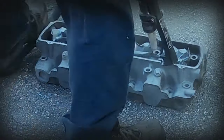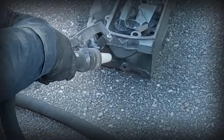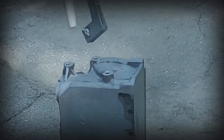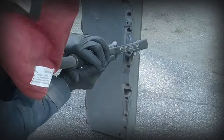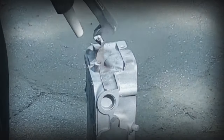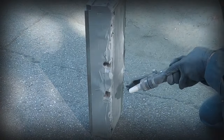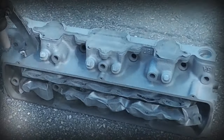First off, the factories didn't use primer underneath their engine paint. And also I find that when I do prime an engine and then paint over that primer, I don't get the kind of durability that I get when I skip the primer. The paint has an easier time bonding to the metal surface after being sandblasted than it would to a primer coat that isn't sanded and then paint applied on top of it. So I skipped that, as they did in the factory.